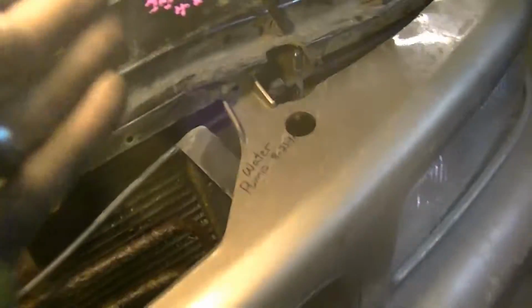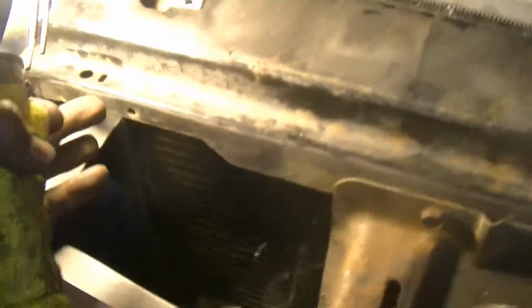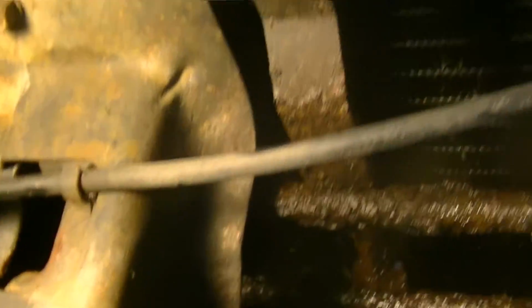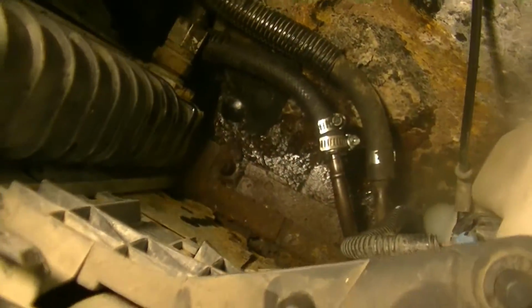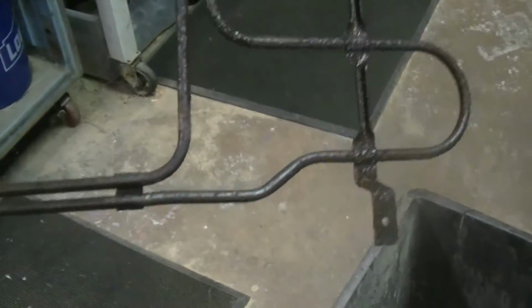to take it off. Okay, I loosened 1, 2, 3, 4, and then down here 5, 6, and there were these 2 clips that you just pry out with a screwdriver. Pulled this out, pulled this cover off, and you can see in here this thing is in pretty rough shape and it's wet. And right there you can see the transition where it gets wet. So this is a cooler, so that means I need a new cooler. So it looks like it's just held on with this bolt right here, and then over here these 2 hoses get disconnected.